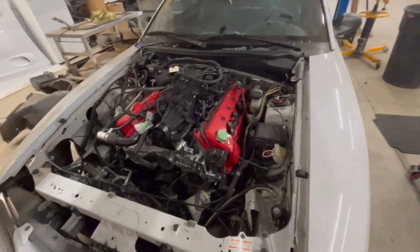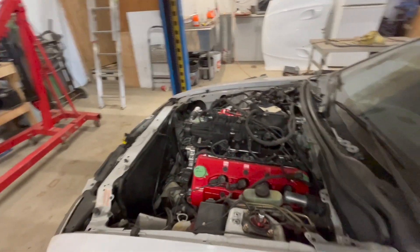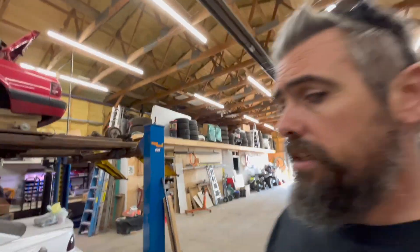As you can see, it's still sitting here — just collecting dust. So what we've got to do is swap the engine mounts out, because it actually has the engine mounts for the notch in it. We're going to put the original mounts in and we needed a release bearing, so we got one. We're going to toss the transmission in today, hopefully get the driveshaft and everything good to go. Then we're pretty much dealing with wiring and bracketry stuff under the hood. We've got to get the car pushed out to the hoist and we'll probably have to hang the motor to get the mounts out.